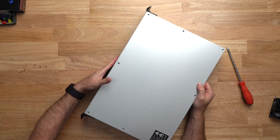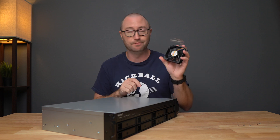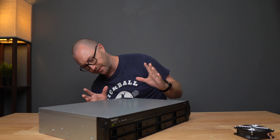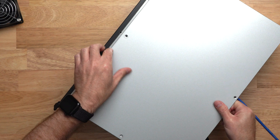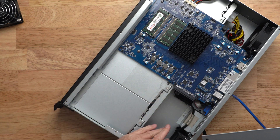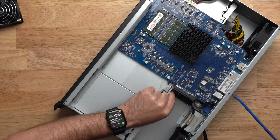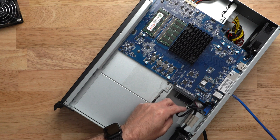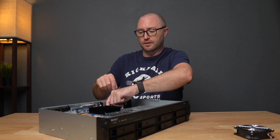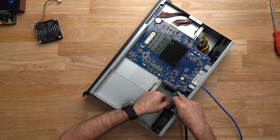We'll hold off on the screws for just a minute and plug this thing in to see what kind of noise reduction we got with the new Noctua fans versus the original stock fans. Right away I hear almost like a little vibration or something hitting something — something's not quite right. It turns out the power supply fan right here is hitting this cable, so I need to rewrap this cable a little bit. I'll undo this tape and do two routes through the tape with the wire, and that should hopefully fix that issue and keep it out of the way.